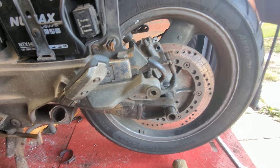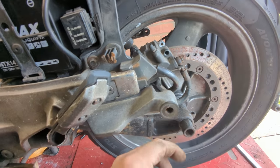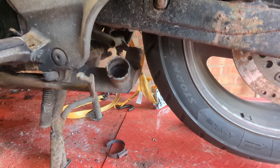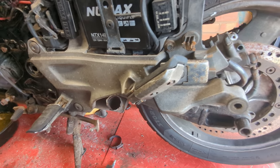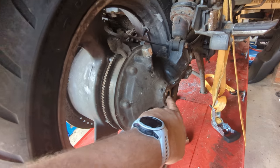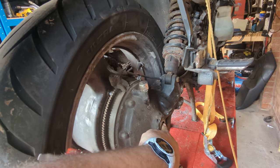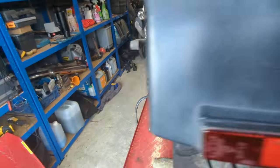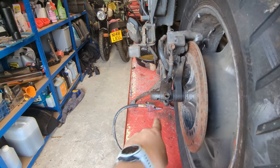Welcome back, let's get straight into it. You might notice the exhausts are missing down there on my shelf. That's this bolt here for the rubber, and then if there are any clamps left, the clamps down at this W-shaped piece down here - both the ones on this bike were rotted off. Once you've done that, there's a big bolt here. I used a size 27 because it's the closest I had, but it feels like there was a bit of slack so it might be a 26.